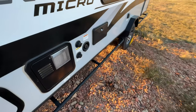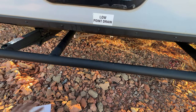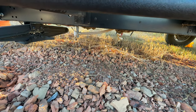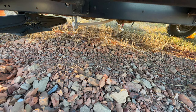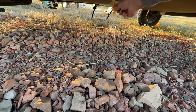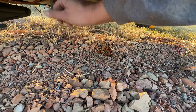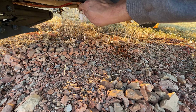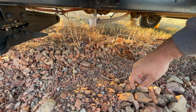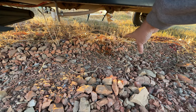Go around to the driver's side and open all the outside drains. Down here there's a red and a blue and then the clear — not including the sewer vents. Just take and twist those knobs. Your water tank opens with this valve; when it's in this position it's open, so that means it's draining if there was fluid in there.